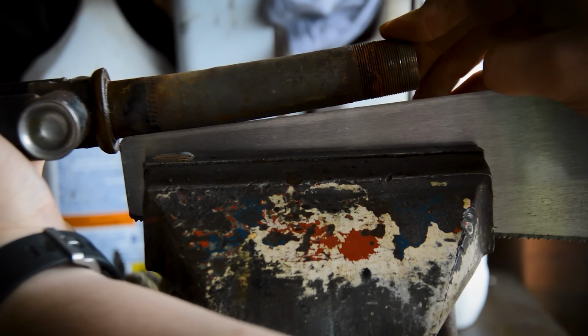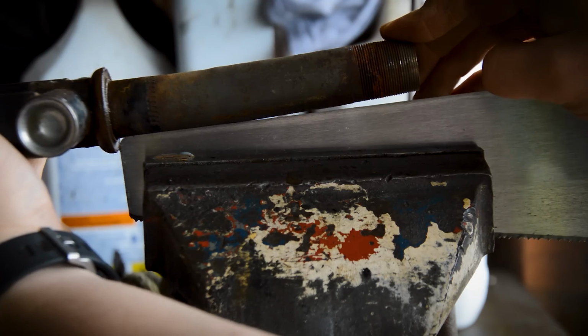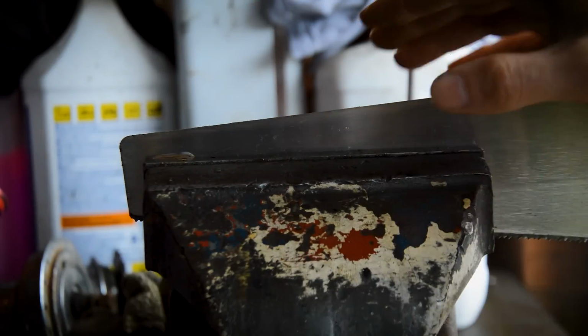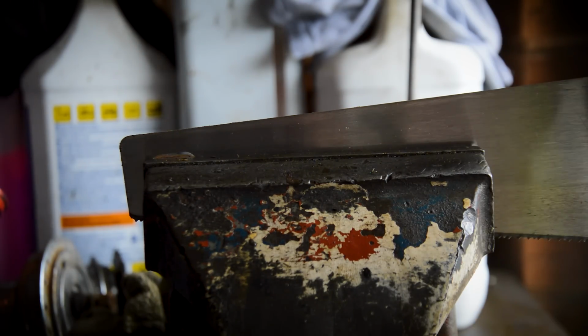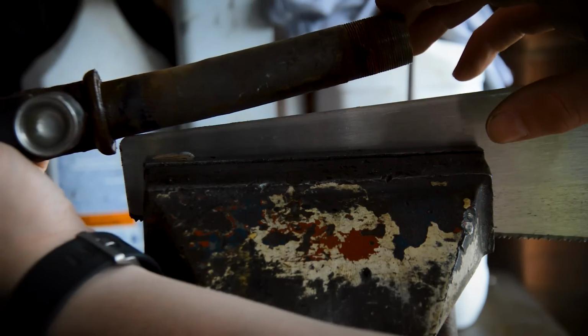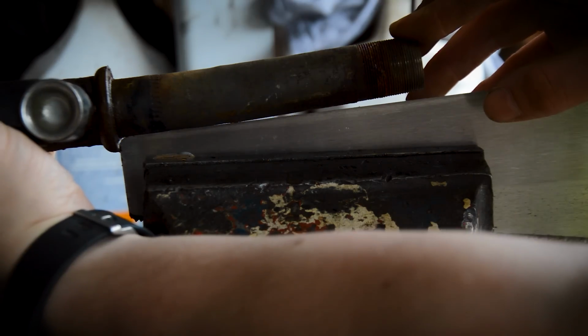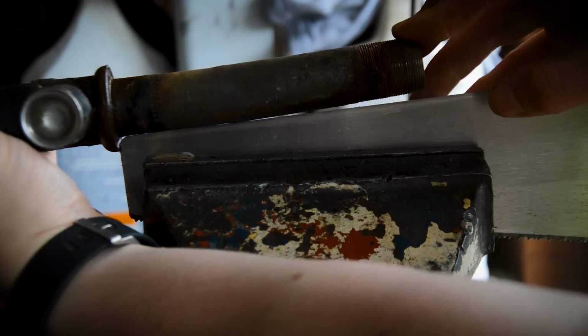When that is in the steer tube, that is going to be causing some binding because the bearings aren't going to be running on a flat surface. So if I want to save this, I'm going to have to get a steer tube replaced. Now that would give me the chance to replace it with a 24 threads per inch one, which would be easier to work with. But anyone who's worked with a bomber before, let me know, but I'm pretty certain this should not be rocking like that.